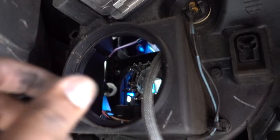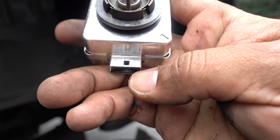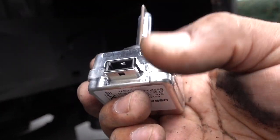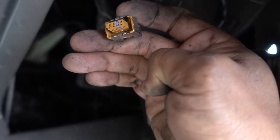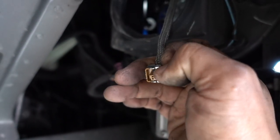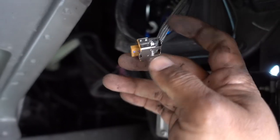I don't know how much I can show you, but you're gonna feel it on each side. You have to just move it to release the clip. If you see here, this little cutout and the other one on the other side — it has two little clips which are very small, one in here and one in here. You just got to pull it either with a flat head screwdriver or with your finger. You can do it with your finger; that's what I did. Pull it on both sides and get it out.